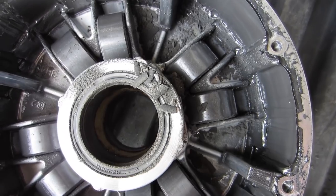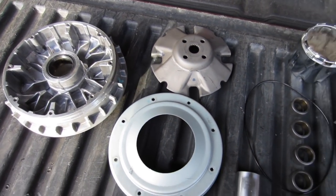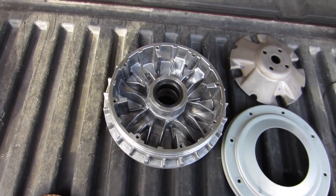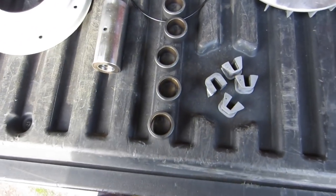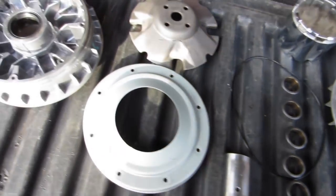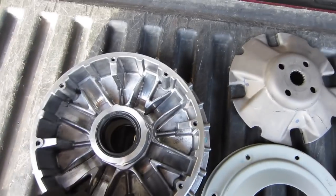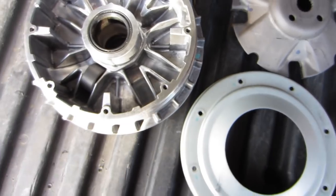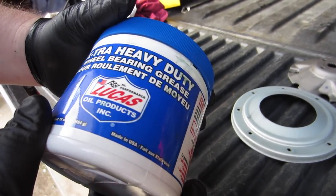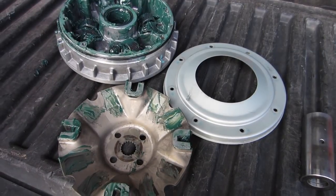Now is when it gets messy. I'm gonna clean that up. Got all the pieces cleaned up now — we're gonna start putting them back together. Cleaned up the surfaces of the clutch with a Scotch-Brite pad on a die grinder — pretty clean in there. Your rollers, cover, cam plate. We want to put about a tablespoon full of grease in each roller hole. They recommend Yamaha Grizzly grease to grease these clutches, but couldn't get any in our town, so this should work pretty good too.